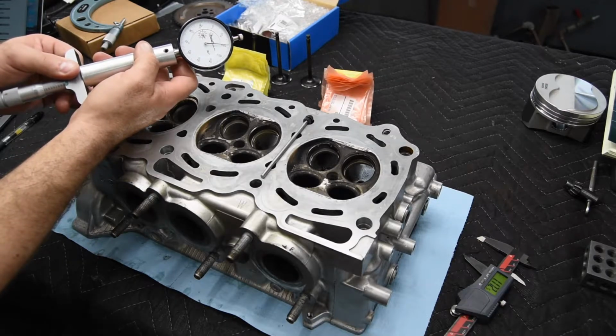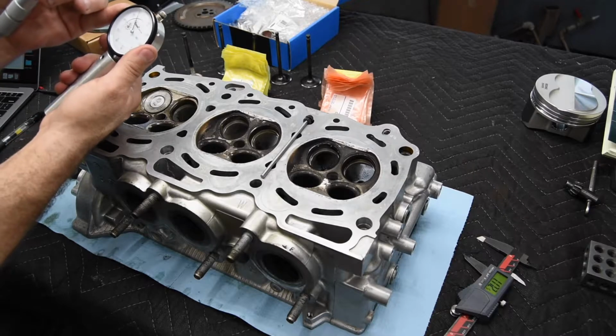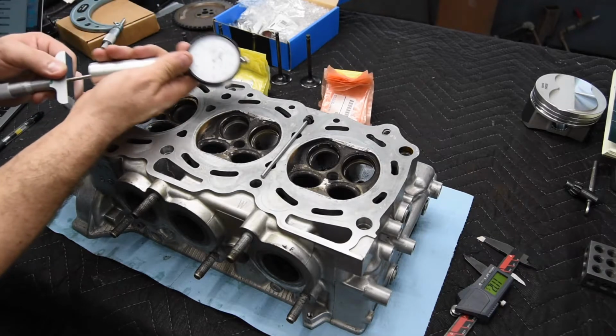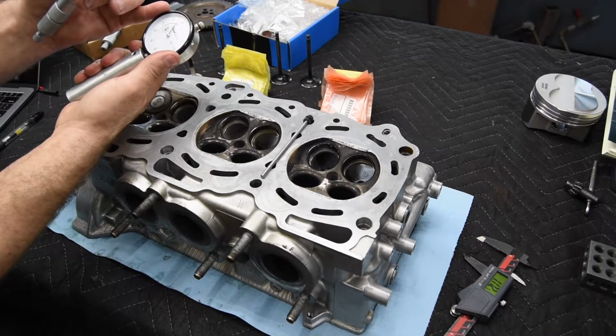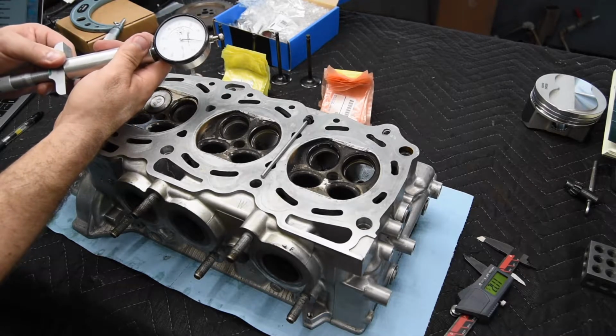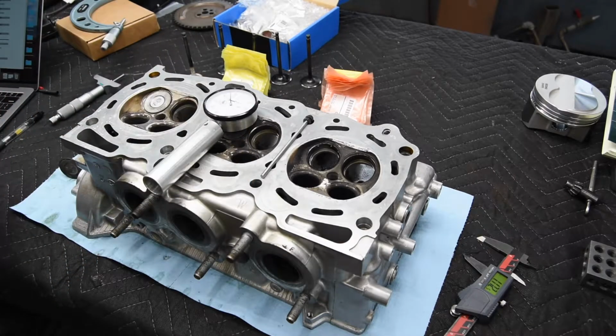and I'm going to take my gauge here and see I'm off by about 20 thousandths of an inch. So I just need to look at it and say I'm going to move it over 20. There's 5, 10, 15, 20. And I just like to get it close to 0. So I'm off by 1. And there we go. This is going to help me verify what the valve height measurement is on the cam side.